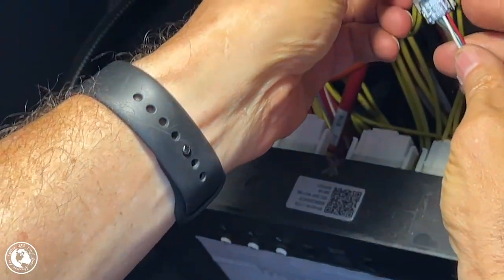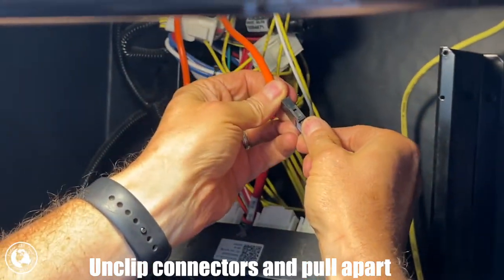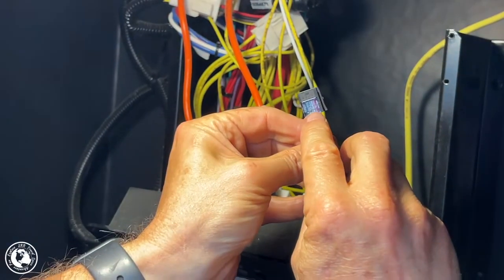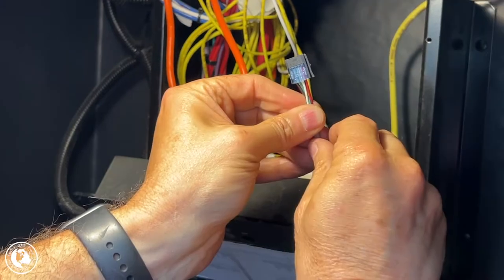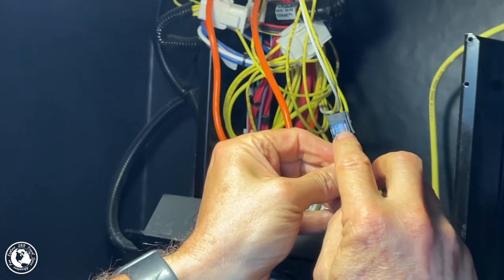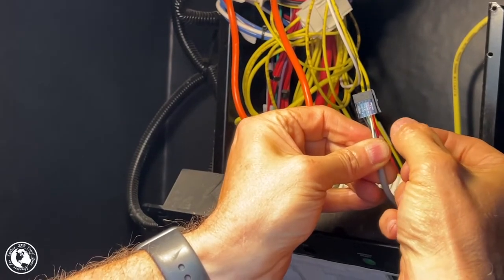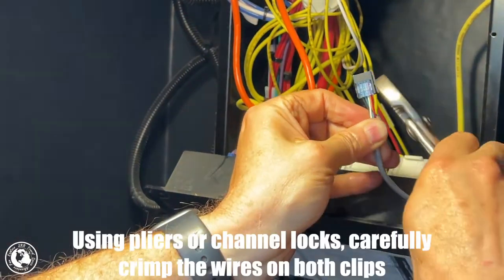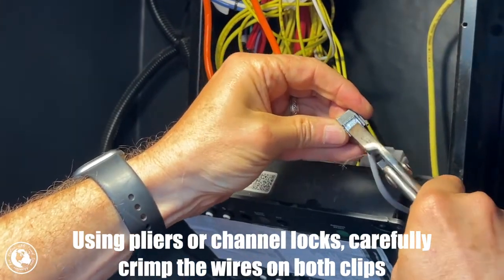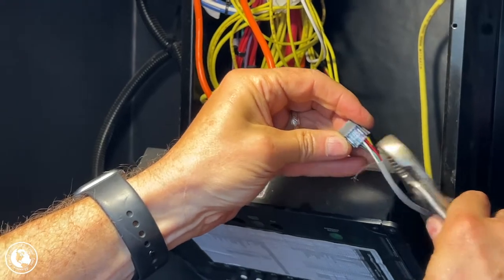You see there's this little tab right here that releases the lock so that you can pull the connectors apart. And if you'll notice, there are four little silver dots — those are the crimps that go into the wires and are crimped with pressure to make contact with the wire. By taking my pliers and pushing on those, it pushes them in more solidly, more firmly.